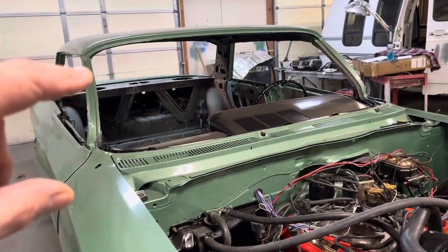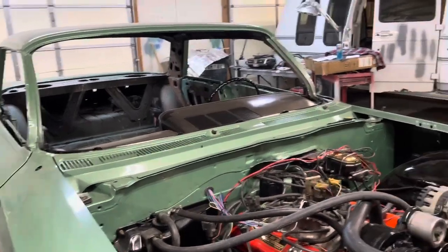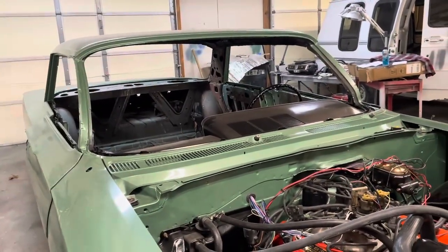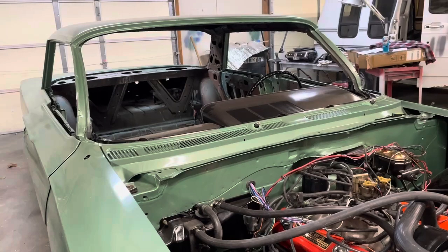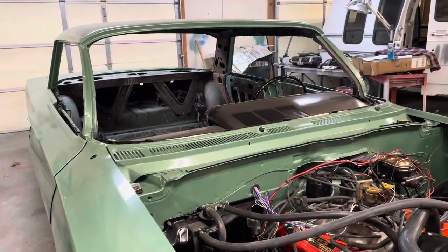Like I said a few times in this video and in the last one, that thing sat in this van since 2004, hasn't had power on it. So when I turn the key on, the check engine light is not coming on. I rechecked the wiring. It looks like it's right. I know the bulb in it is good. I tested that.